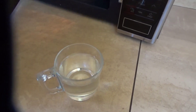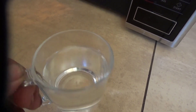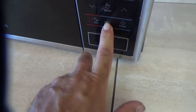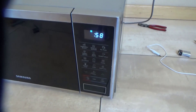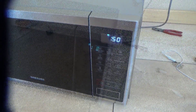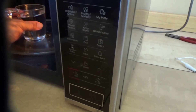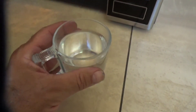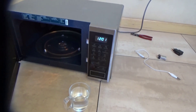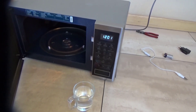Put to the test on the second attempt after changing the capacitor. I'll leave a link for the capacitor in the description of the video and another link for the fuse on Amazon. Let's put a glass of water in, close the door, and put it in for a minute. I had doubts about whether it was going to explode or not. Okay, there are two seconds left — one second. Let's see the test. And it's hot — yes sir, it's burning! Perfect. The microwave is working now. The problem was the capacitor. The capacitor caused the fuse to blow. He changed the fuse but didn't change the capacitor, so the new fuse blew again. Now with a new fuse and a new capacitor, it's working perfectly.